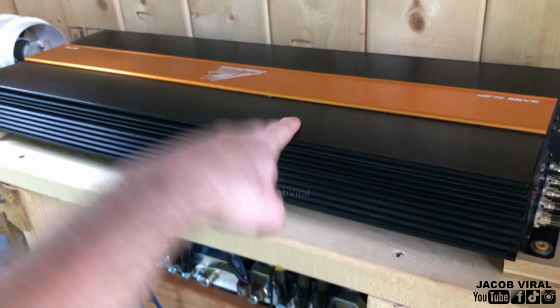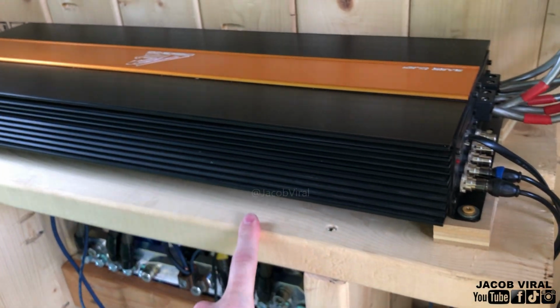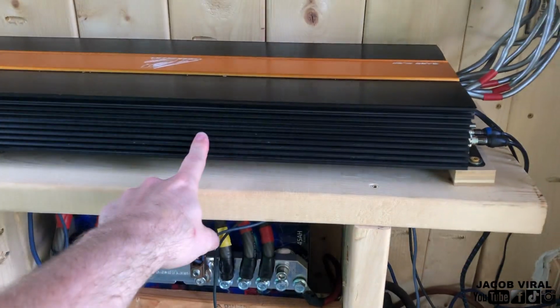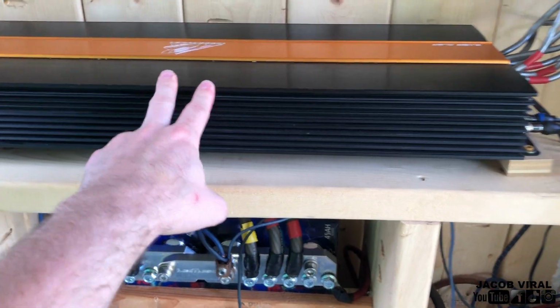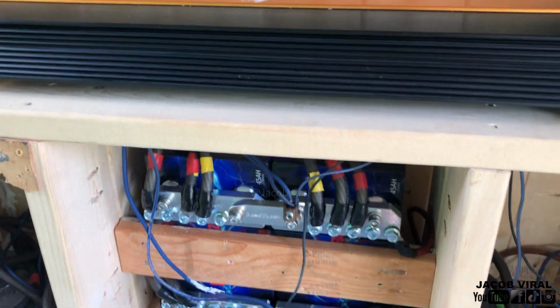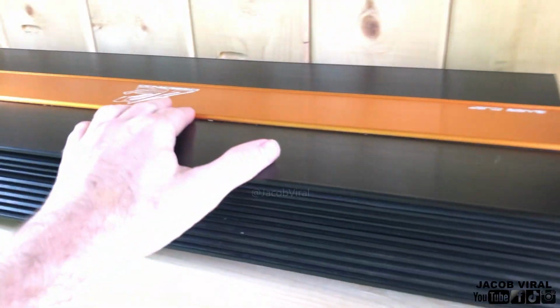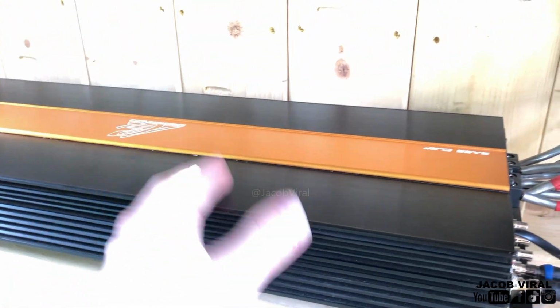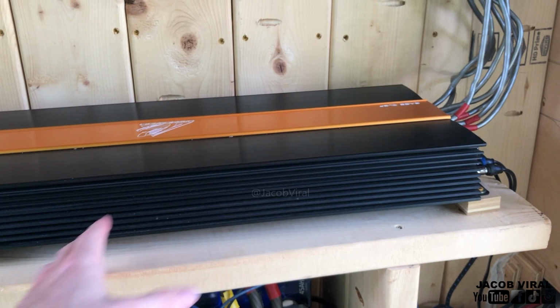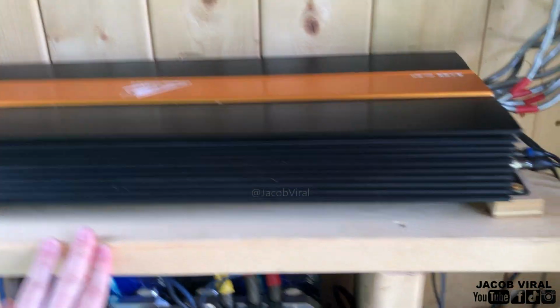All on 1.6K. Stay tuned for more videos as well. I'll show you burp results, clamping it to see how many numbers it is, as well as how much wattage I'm clamping out of this. So I have some videos on that. Also some real world tests on the low end. We'll see how the system meters on the low end as well, so see where my low peak is. Right now it feels like it's around the 24, 25 hertz for the low peak. And my high peak is, as y'all saw, 48, 49 hertz up to 51 hertz, depending on how the seat is.